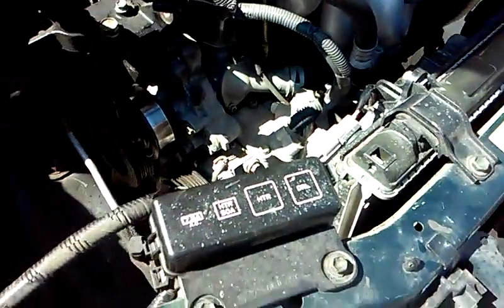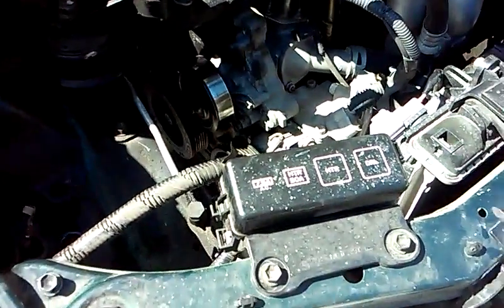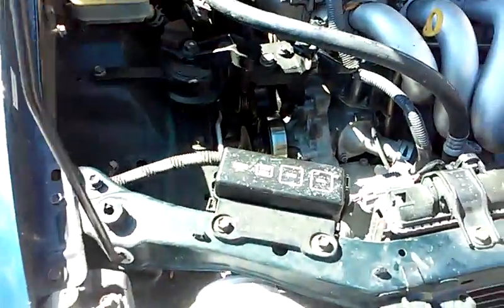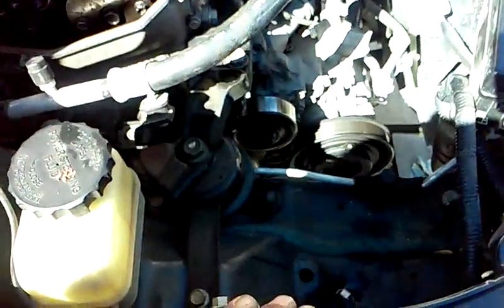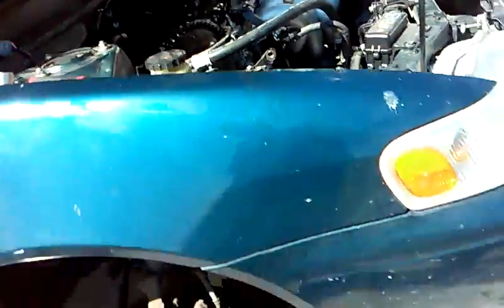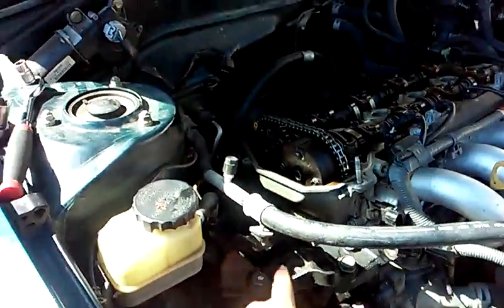Replacing the water pump is something you should go ahead and do. You can get a kit for the water pump — pretty cheap, actually. For the timing and everything, I believe there are kits from about $150 to $200, depending on quality and manufacturer. We will definitely be replacing that water pump. So as you can see, we went from disconnecting our battery, to removing our throttle cables for more room, to removing our washer fluid reservoir for more room, then removing the belt and the alternator. Now we have our jack set up supporting our engine, and we're going to go ahead and get the support bracket out of the way.